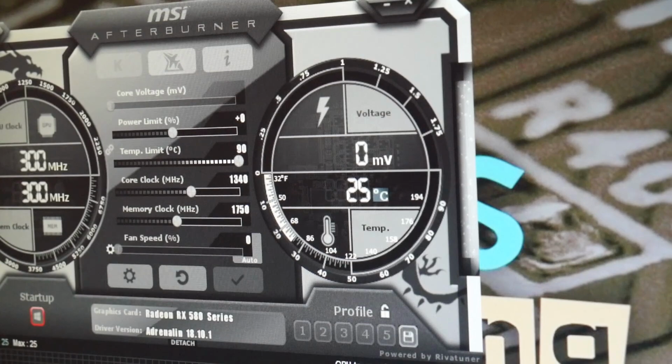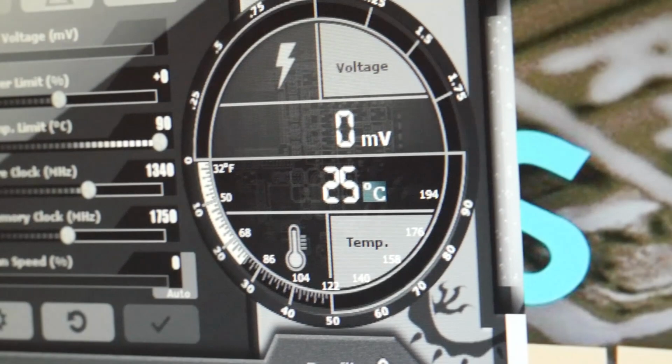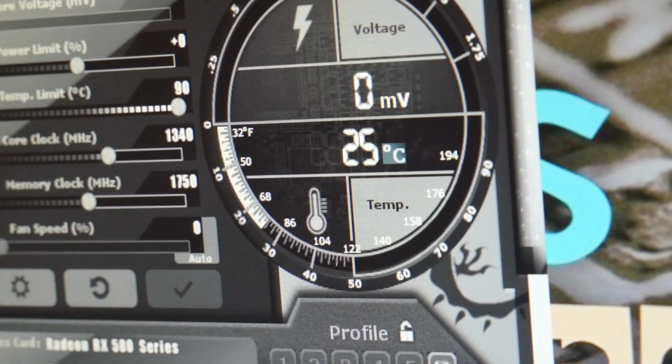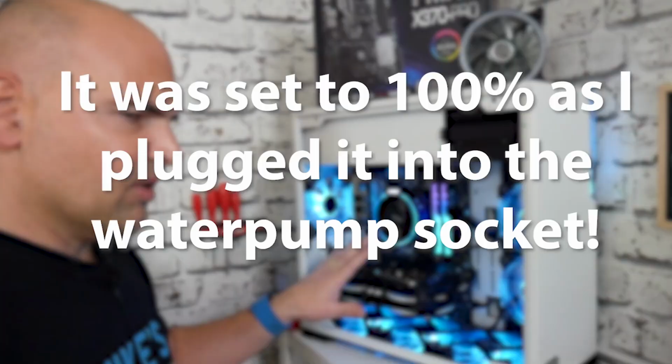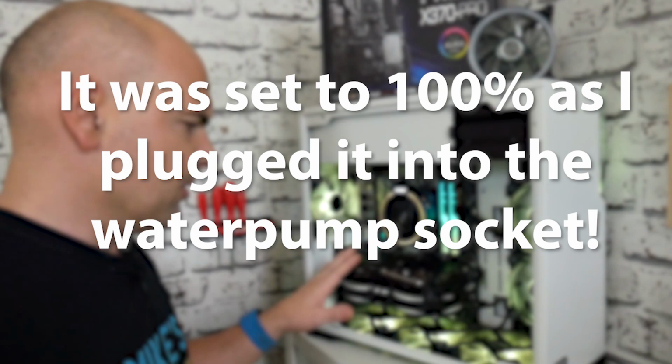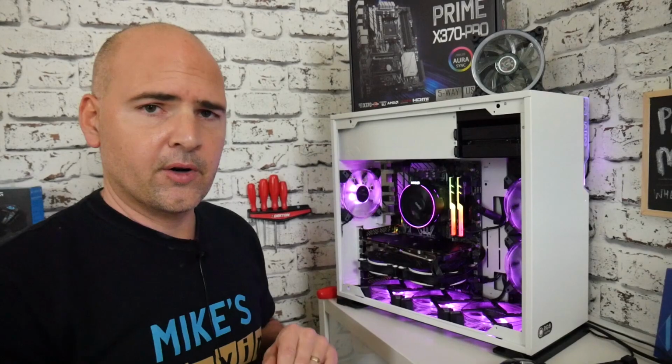We've got a lot of cooling going on there. So at the moment the BIOS is set for, I think, about 60% RPM on the fan. So that's pretty much the most I would put up with in that case. I'm going to go into the BIOS and change that and set it to about 40%, I think. But it's extremely cool to the touch, although it would be because I've just turned it on. So I'm going to go ahead now and put some Far Cry 5 on, which should really generate a little bit of heat in there, and we'll come back in a few minutes and see what the temperatures are like. So we'll see you in a bit.